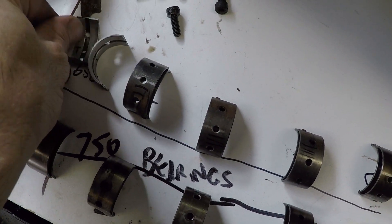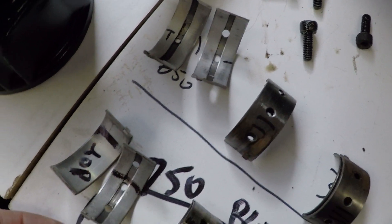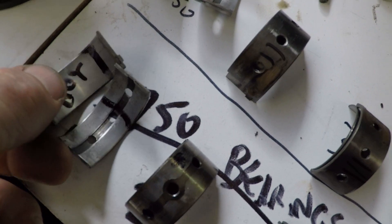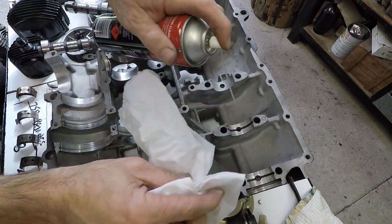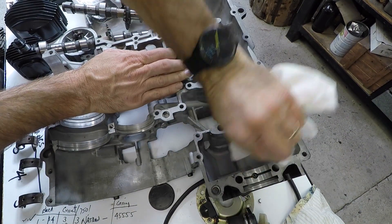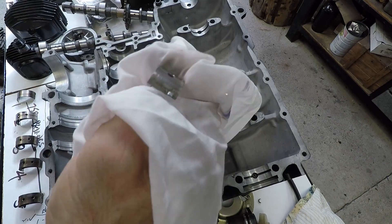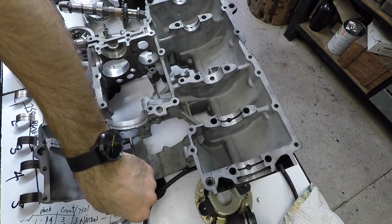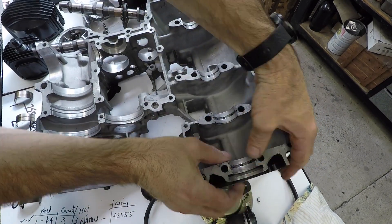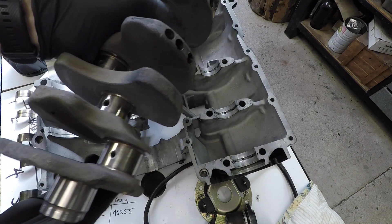I did that as a check, but what I've done is laid out the 650 bearings at the top — these are in quite good condition and they've got grooves top and bottom. The 750 bearings have been changed to only be grooved at the bottom. What I've decided to do is fit them in and measure them properly using plastigage. First go is using the 750 bearing — you clean them up, no oil whatsoever, fit them into the casing properly. Here are the bearings going into the lower part of the casing, and then I get the 750 crank and lower it in carefully.